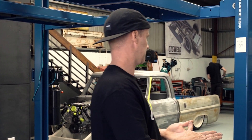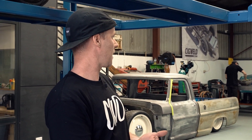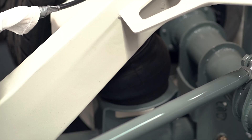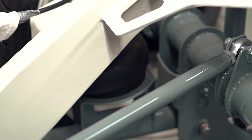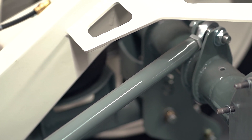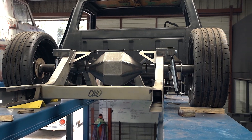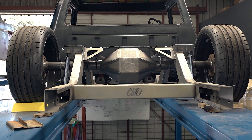The main challenges when building these cars and getting them on the ground — clearance issues are always fun. Everything's clearanced down to the millimetre; we don't have a lot of room to get it wrong. Basically everything is so dialled in with CAD that by the time it gets made, it just fits. You find the digital side has made a massive difference. We can take a long time to do the joint design of the whole chassis, but by the time it's cut — between four and six weeks — it's on the ground rolling.